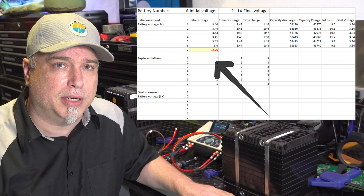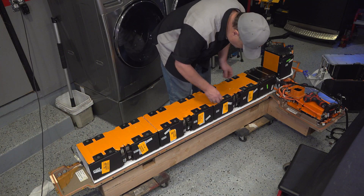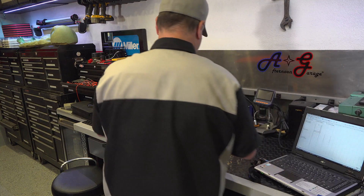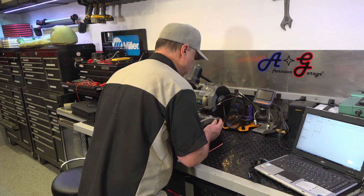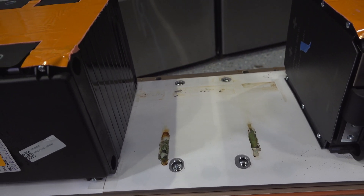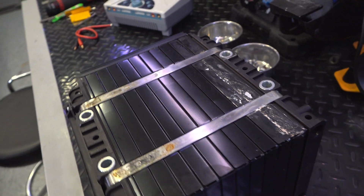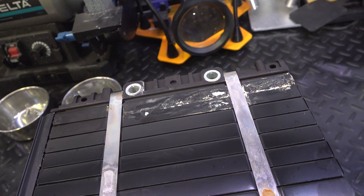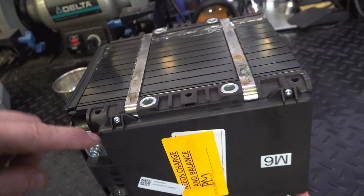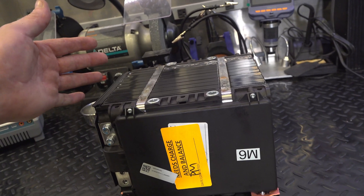You can see on this one where it had low voltage on the last group of three cells. After I pulled that, you can see right there — it looks like a couple different cells were leaking. This was a problem with Fisker batteries. Fisker had a bunch of battery recalls, and ultimately that's what ended up making the Fisker not such a good car. Its demise was kind of the A123 battery problem. So I think the thing to do is take the BMS out, mark it, and then take these band straps off and see what we find in there.